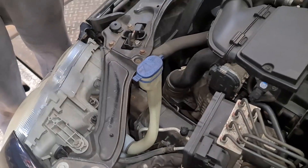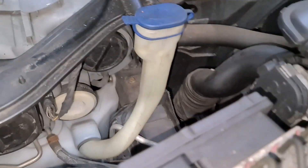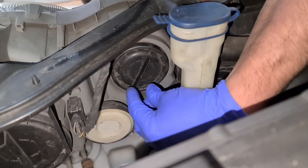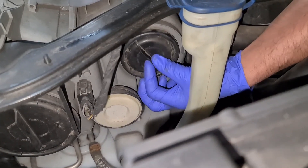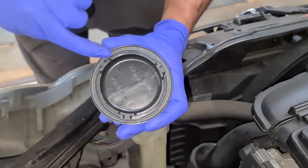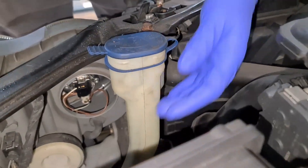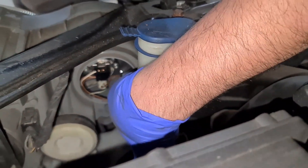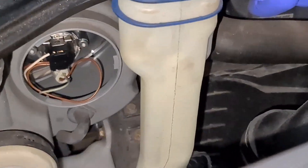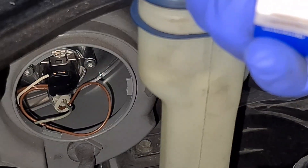Now the bulb we're doing — both of them. That one's a bit awkward, this one's quite easy. So it's the inside cover here. I've got my gloves on. What you've got to do is remove this cover. Just remember when you do remove this cover, you've got to check the seals around here — make sure they're intact. Put that to the side. The bulb we're replacing is the brown and grey cable, and I've already got the bulb right here, which is a 501.